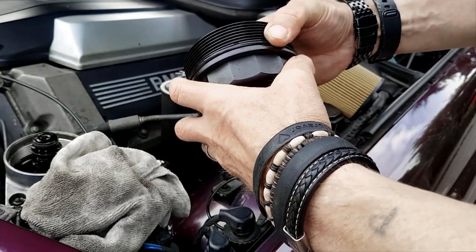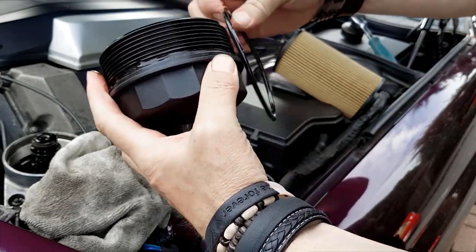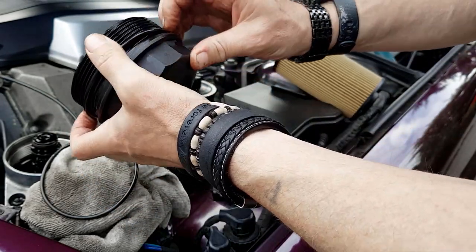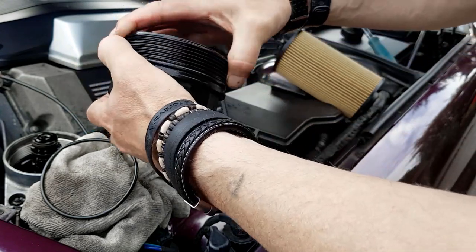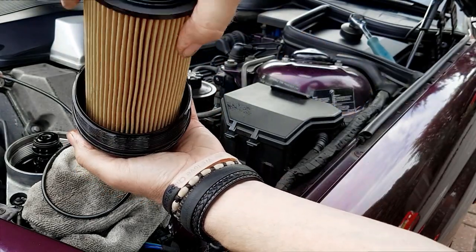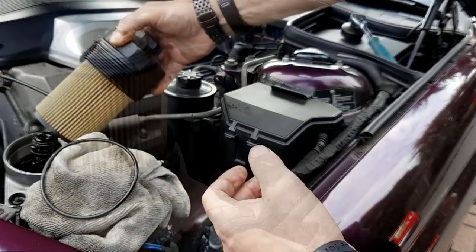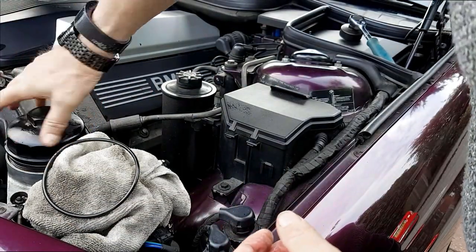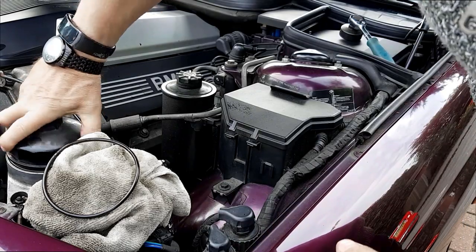The oil is almost all out, so let's put the new o-ring on the canister lid. My hands are oily enough that I can apply oil to the new o-ring — you need a bit of oil on there or it's quite hard getting the lid back on. Then poke the filter in the right way up; it clicks into place and should be well held in there. Push it back in — possibly I should have taken the oil back off the lid again because it is rather slippery.